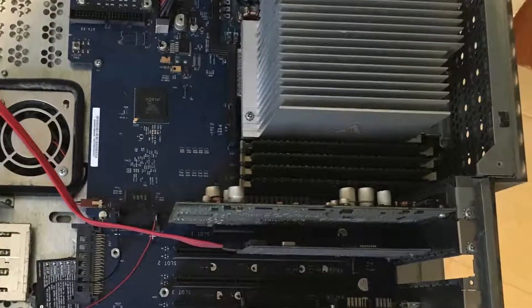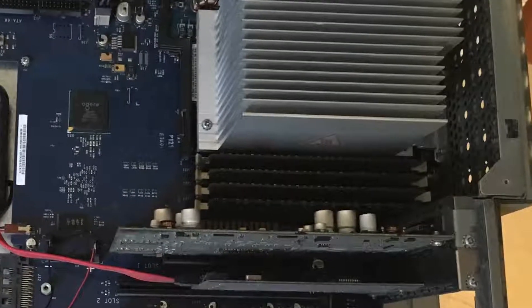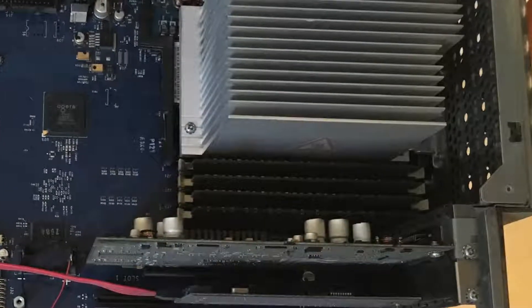I'm going to go ahead and try to install a solid state drive in this computer and see how it behaves. We are going to use the spinning disk in order to format the solid state drive, then remove the spinning disk and put it back into the Mac once we burn the DVD image for the installation.